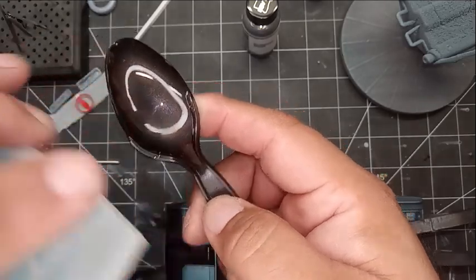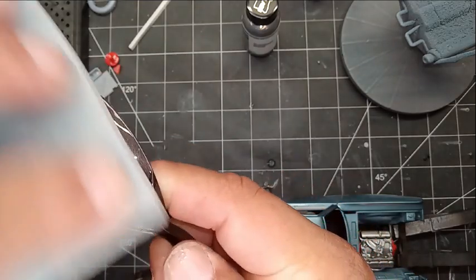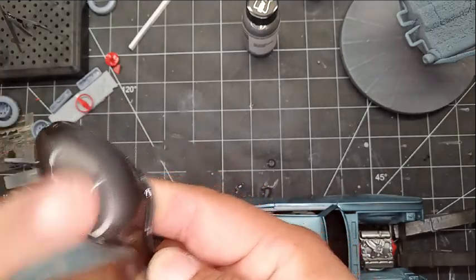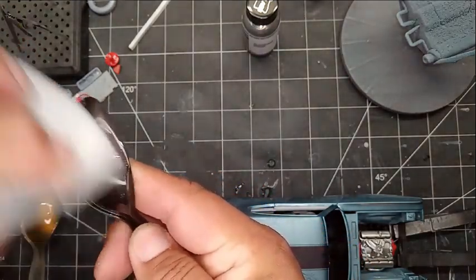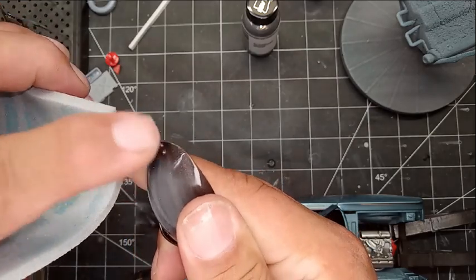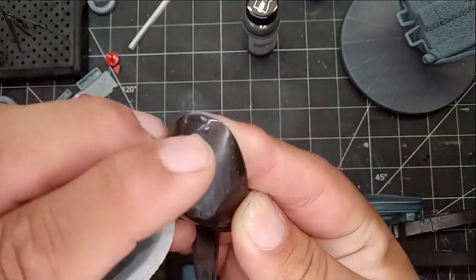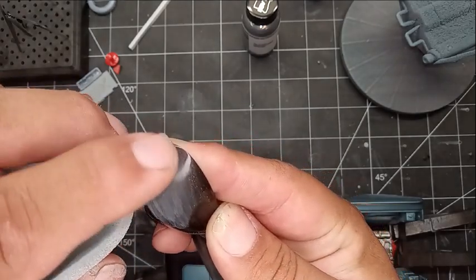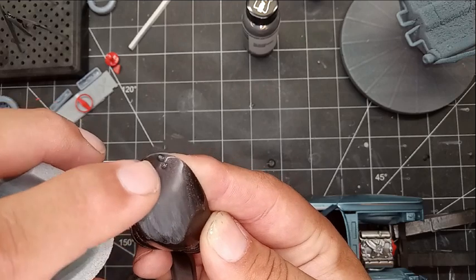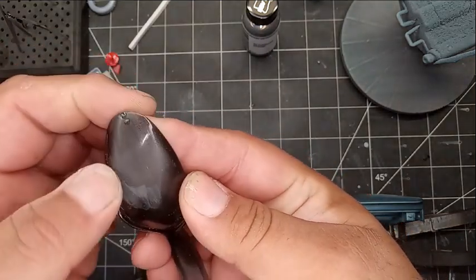I can feel a little imperfection right there. The kind of paint this is — this is a 2K clear — so it's not really important; these are test spoons, just trying things out. Now something actually got attached up here, lint from one of my microfiber towels. If you look right here, these are not specs — these are actually parts of the fiber that are in there. You see where it's a little shiny around each of the fibers. What you want to do on a low spot like this is keep sanding it until that goes away, because you want it uniform.